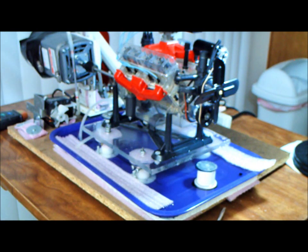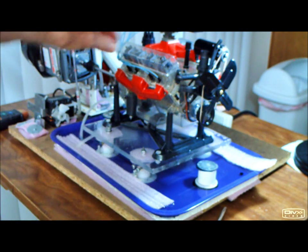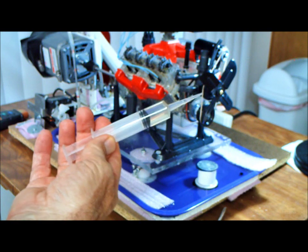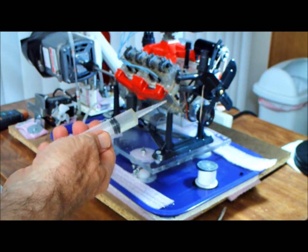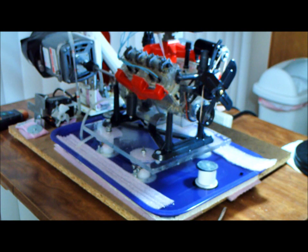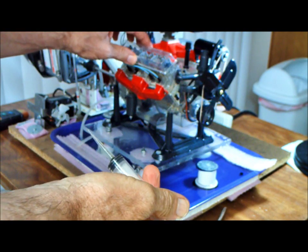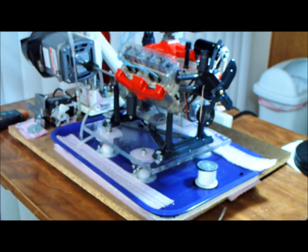Now that it's mounted to the test stand, we're going to take off the valve covers. I have some lubricant here — the lubricant we're going to use today is glycerin. This is what I've been using lately; I've used all different kinds of lubrication and glycerin seems to work pretty good. We're going to lubricate the push rods, the rocker arms, and the valve stems. These take a lot of lubrication to get up there, even though it's pressure fed.